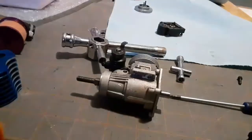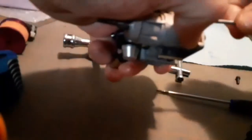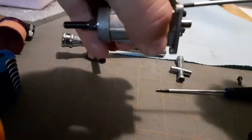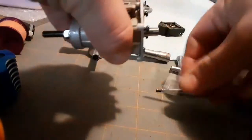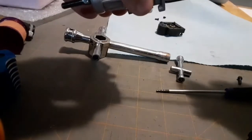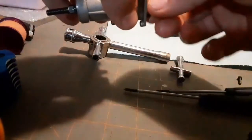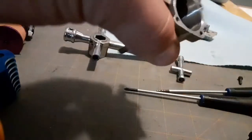There are inside screws right here that we need to take off. Let's start breaking these loose. All this is, is a plate with a bearing. More than likely there'll be grease or oil on the backside — that's okay, it's a two-stroke motor, just expect oil; that's just the way they run. There's no oil in the bottom end like a car motor, because to lubricate itself it uses oil in the fuel. Now we've got the back plate off.